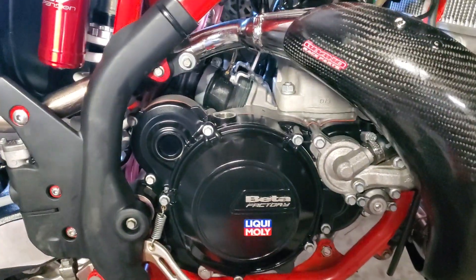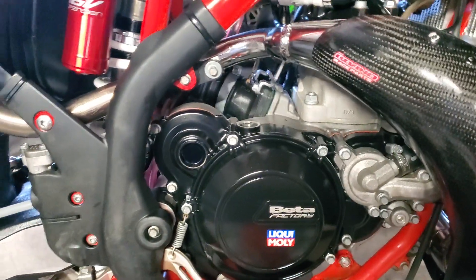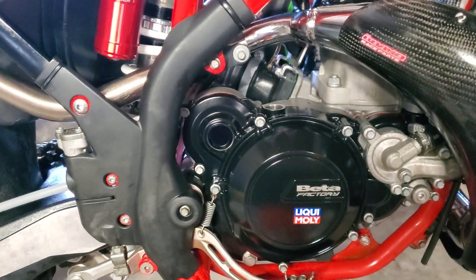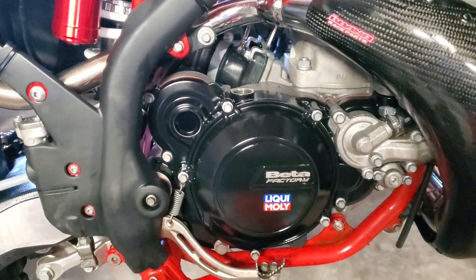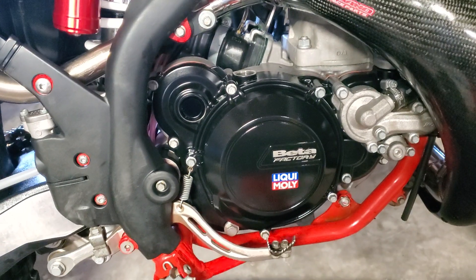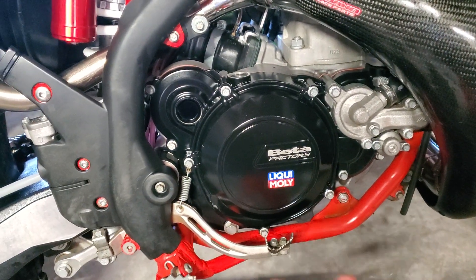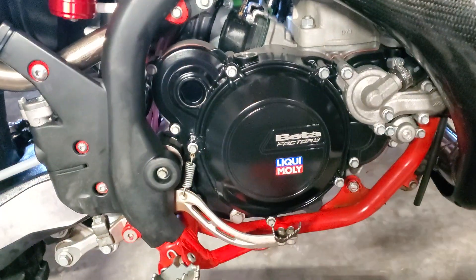You've also got to run it first because you want to get the bike heated up and get all the dirt and stuff in suspension in the oil — that's one reason they have you heat it up. Another reason is that when the bike has been sitting for two weeks, all the oil drains out of the upper engine. If you change the oil cold at that point, you'd have kind of oil starvation in a sense.